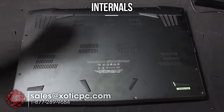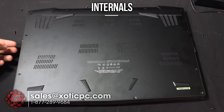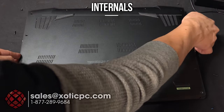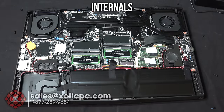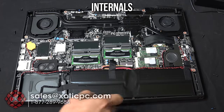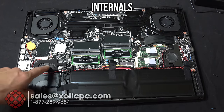We're popping open the bottom of the computer to look at the internals. There are screws around the perimeter — use a T6 for those. Find a good spot to start lifting, usually near where the ethernet port plugs in. Once you get it started, it just lifts away. Starting from the front: here is the internal battery. There's what looks like an open bay — likely where the one-terabyte hard drive would normally go as the stock drive. Speakers are right here as well.